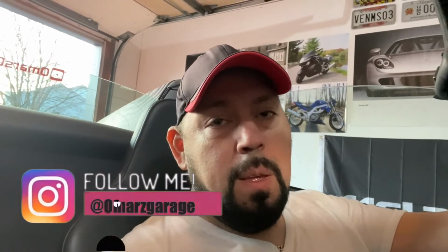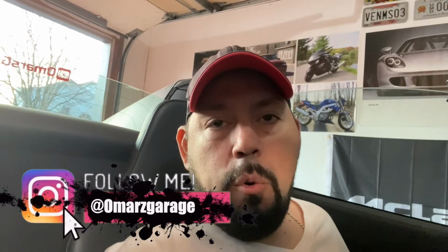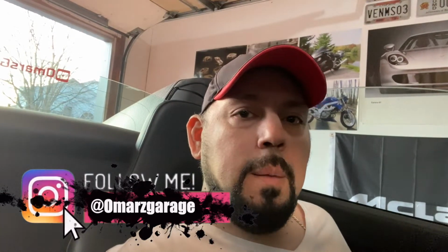But I'm going to try to follow some of those instructions. 30 miles per hour, and just brake with light force a couple times, and then let them cool down. Drive for 2 miles. Then go ahead and go to 60 miles per hour, then brake. I'll put the picture in the video so you can see what exactly I'm going to do. There's not going to be much more other than that. That's just changing the brake pads.